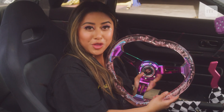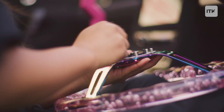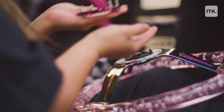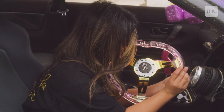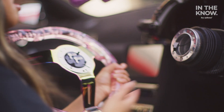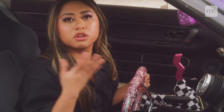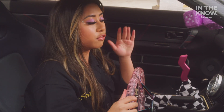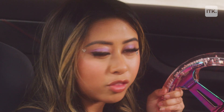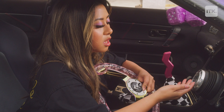For this specific new customized steering wheel, we have to remove the backing which is holding the hardware. Some new ones come like this, and then all your hardware is going to come right off. This little wire will actually connect here, which is going to control your horn. The reason I was able to pull all this out without being electrocuted is that the battery is disconnected from the whole system — that's why the horn's not going off the whole time. This one has two inputs where you can plug the horn, because usually there's two wires: a power and a ground.